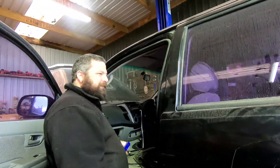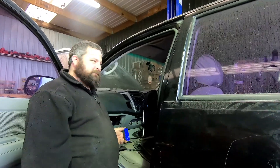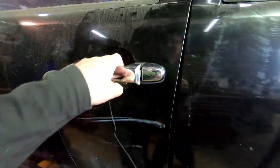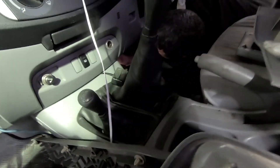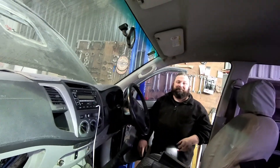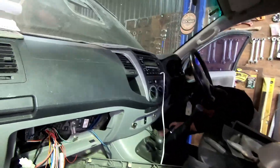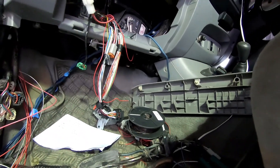You'll remember for next time because you've got another one to wire after this one — same vehicle, same wiring, no four-wheel drive, different motor. For the fuel pump wiring there's just a little connector right there. So I just cut it off, put a terminal on it and run a wire across to that. They put the wiring in for the diesel for a petrol pump — they knew this was going to happen. I run a wire along in behind the heater there and connect into that.